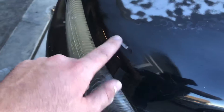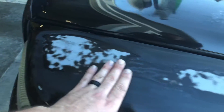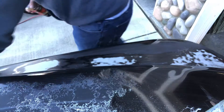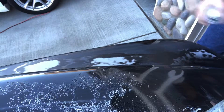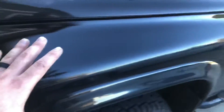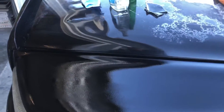I got down here too because there's a little spot that was really driving me nuts. Nice and smooth — I don't feel any of these anymore. I'm going to get the paint and clean up anything around it so if there's overspray it doesn't get stuck to the surrounding paint. The orange peel is horrible — I'm going to wet sand it, get it smooth, and buff it out to get it reasonably polished and kind of shiny.